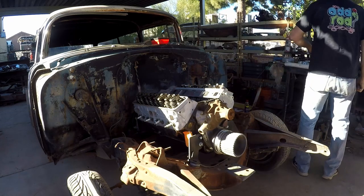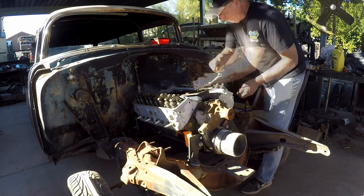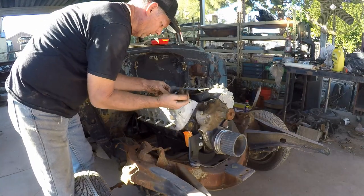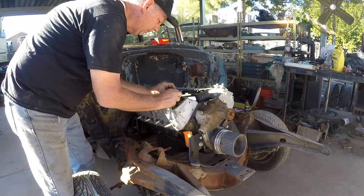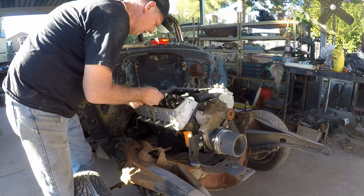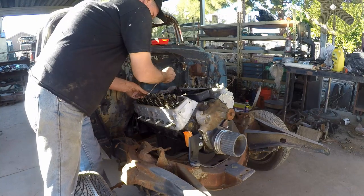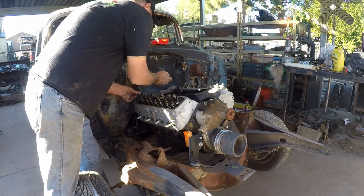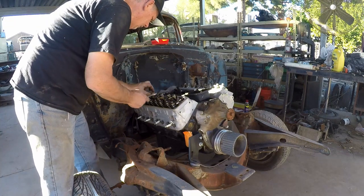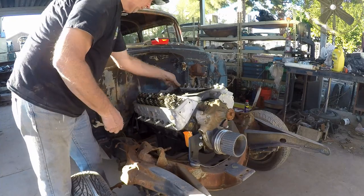That means lots of money. I'm not talking as much as I normally do — I'm pretty frustrated that I spent that much money on an engine and basically have a builder core now. Very frustrating. I just hope the block is saveable, because that could get expensive quick. I know we can redo the heads — if we have rust on the back side of valves, we can get new valves and take care of the seats. But the block is the real concern. Let's get a wrench and get a head off.